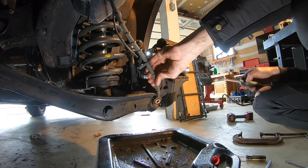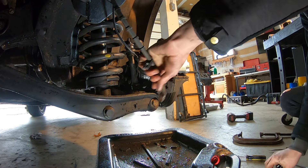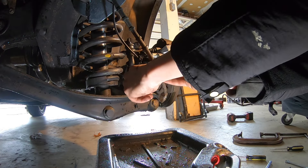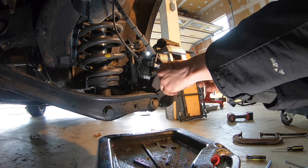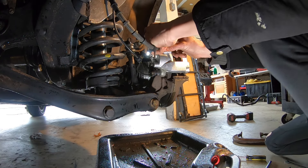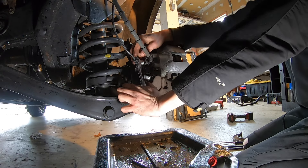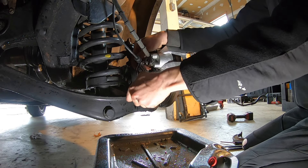I have to get my crush washer off of this. Now I've got my banjo bolt with my new crush washers. I'll leave the link in the description below for the part numbers of the crush washers — you always want to get new ones. They're made of copper and like drain plugs, they're relatively one-time use. When I torque these down, there's really no number — it's a crush washer, so you just go by feel. Go nice and tight and you'll just have that sense where you know that's good.